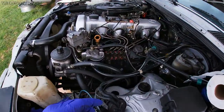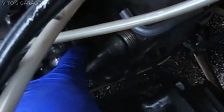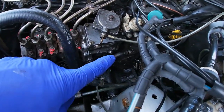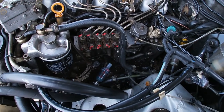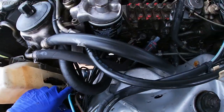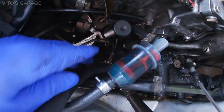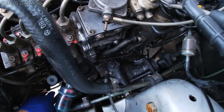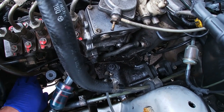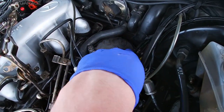The car is jacked up. I re-loosened the oil filter housing oil cooling lines — upper and bottom — using a big adjustable wrench. I also had to loosen the 10-millimeter retainer right there and down there as well, so I can actually move these lines back and forth. Otherwise it would be really difficult.